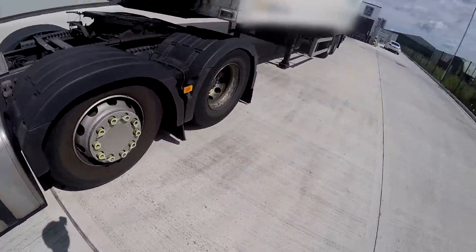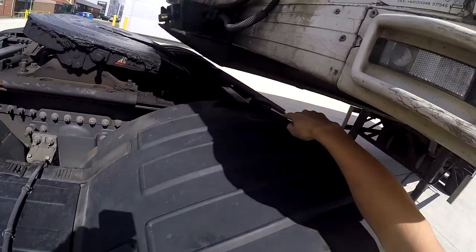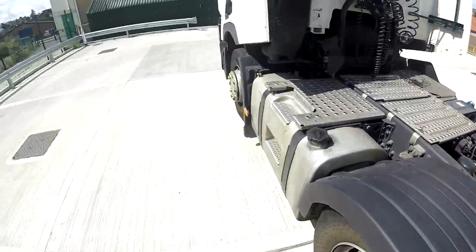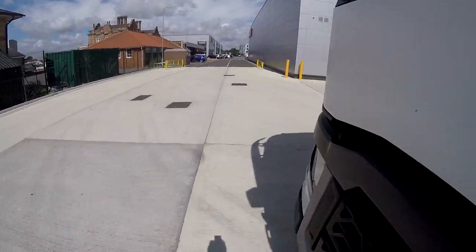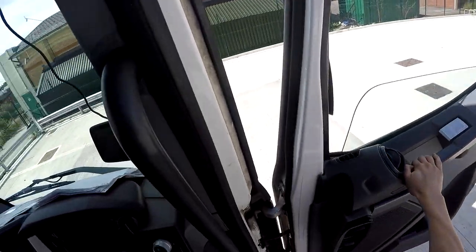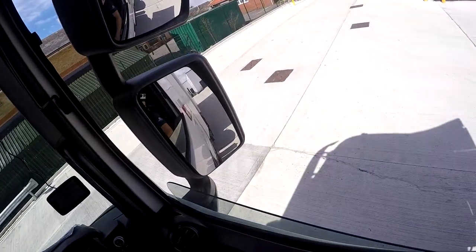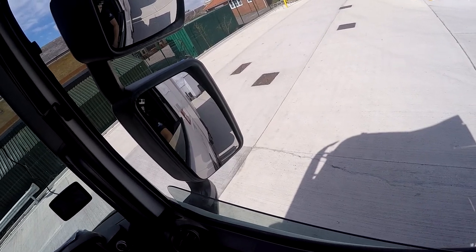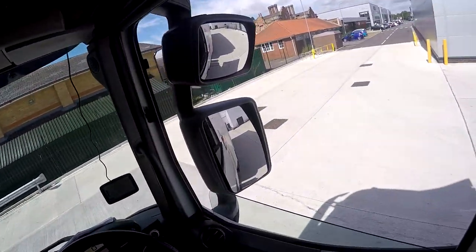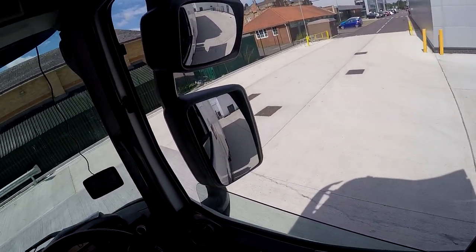You're checking the height of the fifth wheel here — just checking that this lip is not going to go against those bars down there. Just make sure it's going to come nicely onto the fifth wheel, and in this situation you can see it is. So we're going to reverse under it. Three points of contact — we'll do that this time. That's slowly going underneath — you should feel the back of the suspension, the back wheels start to get pushed down a little bit by the trailer. We are just under it, not quite by the kingpin yet.